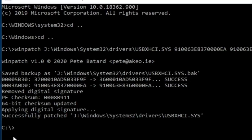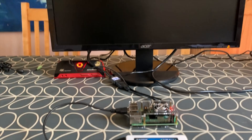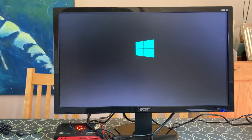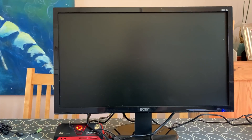I've switched over to the live bit just to show you how this boots up. I've had this not work loads of times with SSD — it's why I haven't covered it before now. The best method is literally just to leave it and let it do everything itself. Don't press Escape, don't do anything — let it boot into Windows. It seems to sort itself out now, which it didn't before. It's rebooting on its own — that's good. Again, leave it, don't press anything.